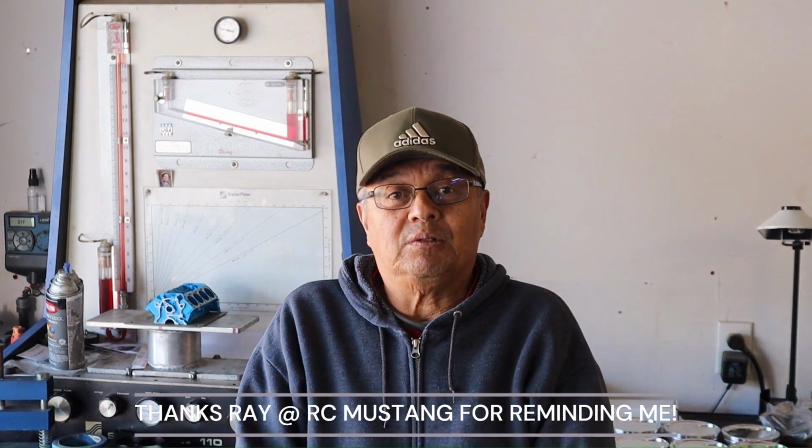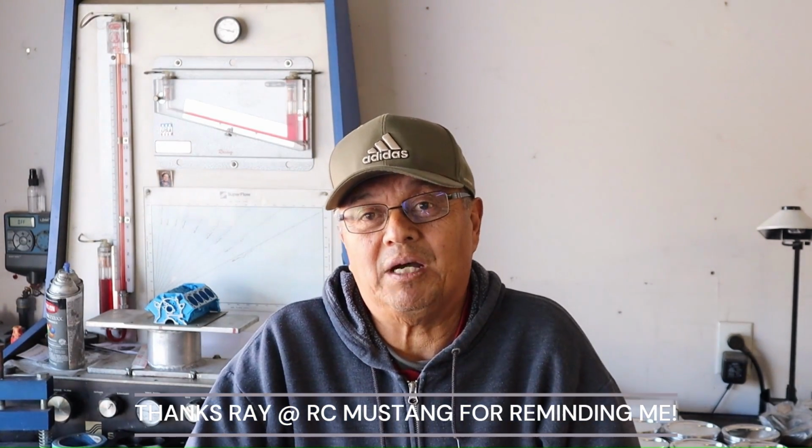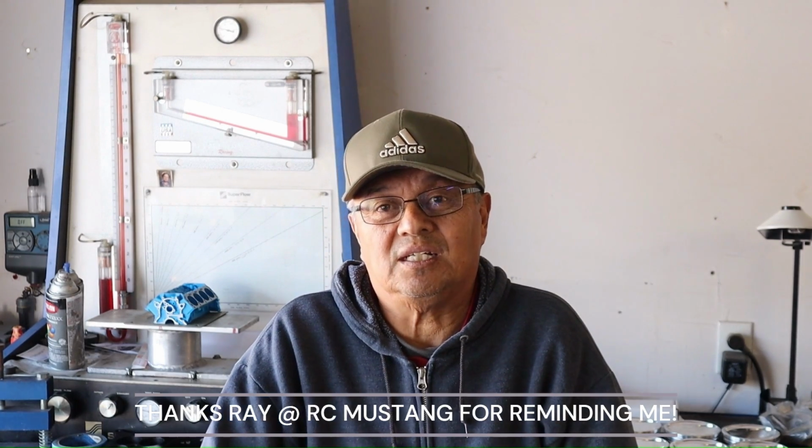That's why when people used to come and say, oh, I got a 60 Windsor block, you want to buy it from me for racing? Because it's thin, it's already 60 over. I go, sure, I'll buy it. Because you know what? I sonic check it and they go over 60. They go over 60 thousandths. All right, so it's not right to say, oh, they don't have enough meat. They do have a lot of meat. Now the 302 HO, that's another story. 40 over, that's pretty much where I'm at. Okay, we got sidetracked there for a moment.